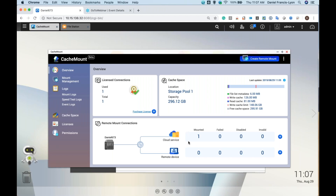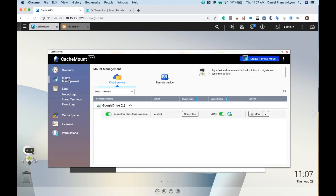The minimum cache space should be 200 gigabytes but you can make it larger — the larger it is the more you can cache to better increase your performance. Over here we can see what has been mounted onto my NAS: here are the public clouds that have been mounted, and here are my other devices. If I wanted to map a folder of another NAS through SMB, that would be a remote device, and to add one I just click the plus sign.